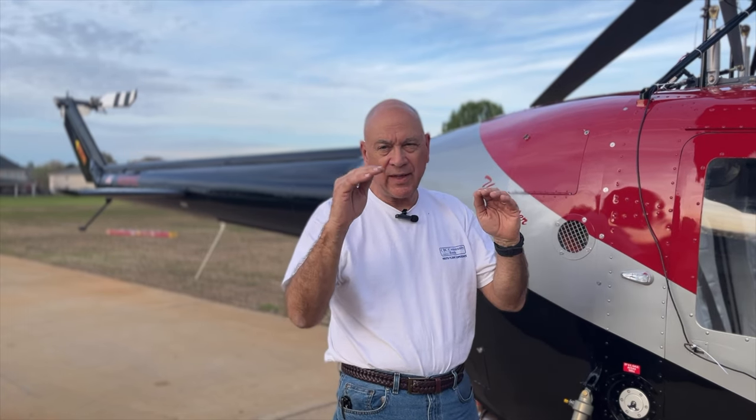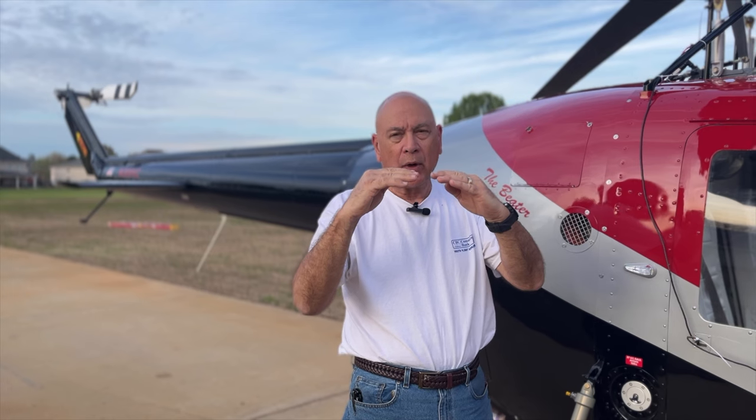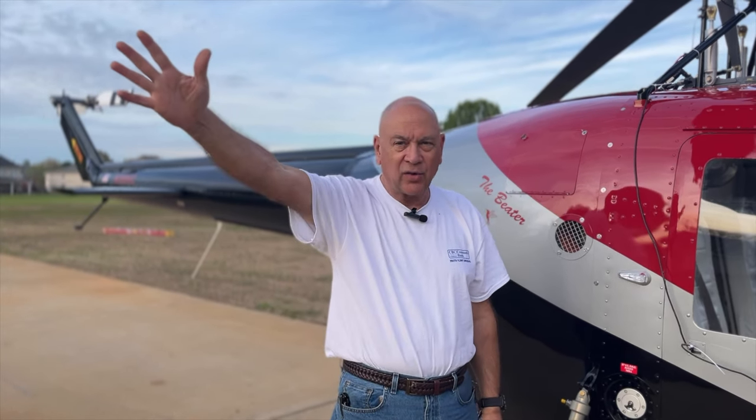So now we're actually dynamically tracking those blades, and you could see one was way out. So I took one washer, brought that blade in. So huge difference on startup and at 3000 RPMs on the ground. Pickup was just felt nicer. And then it took off and flew for almost 0.7 today. It was that much different. So it was nice to stay airborne for that long as well.